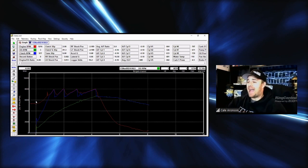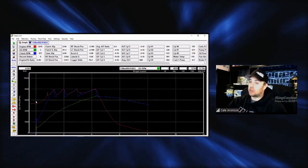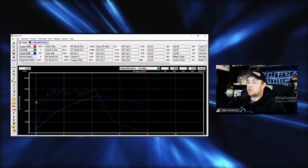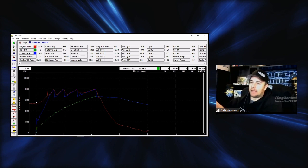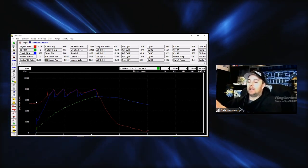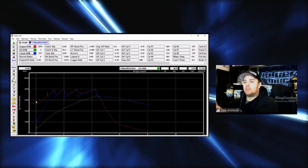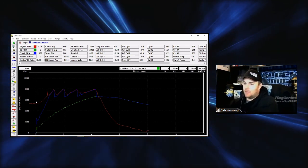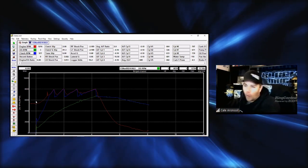If I added that extra counterweight, it would have given me a lot more pressure at launch RPM also. To offset that, we take a little bit of base pressure away, knowing that the counterweight is now going to come in more quickly. So even though we want more pressure at the lockup up high at high RPM, we don't necessarily want that much more at low RPM, because a .980 60 foot is nothing horrible.